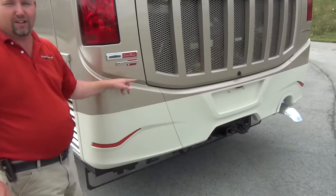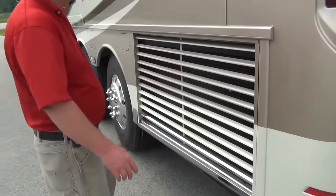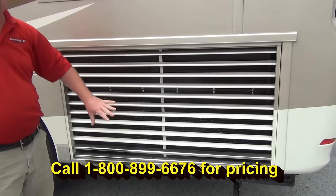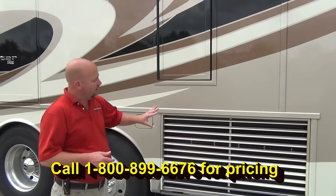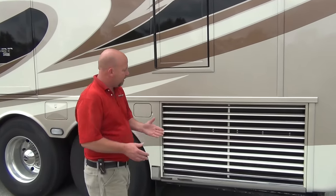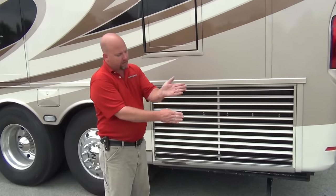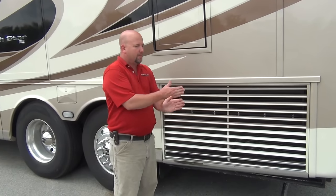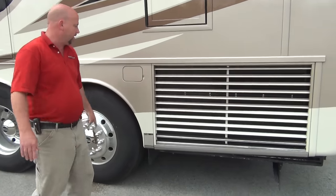This is new - the Ultra Steer Series, which just means the steerable tag axle. Since we don't have a rear radiator, we have a side radiator. The side radiator gets better airflow out to the side of the coach - you get a little vacuum behind the coach going down the road and pick up more dirt back there, so the side position gives better airflow. Also, they don't stack their radiators - oil coolers, transmission coolers, and all - one in front of the other; they stack them on top of each other, so they all get equal cold air. If you stack them front to back, the outside one gets good cold air but the ones inside get already-warmed air. Much more efficient. A little chrome added down here as well.